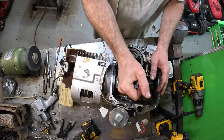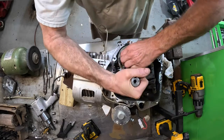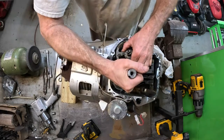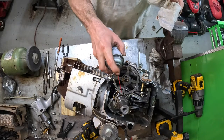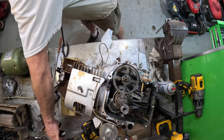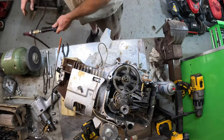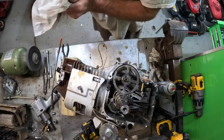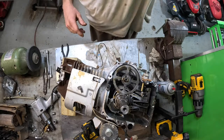on the compression stroke, if I can, and I will show you on the gears themselves. Watch them fingers doing this. Make sure the camera can see that very well. Put a little squirt. Right there is a little dot, and right there is a corresponding dot. That way you know the cam is in the right place to make this booger run right.